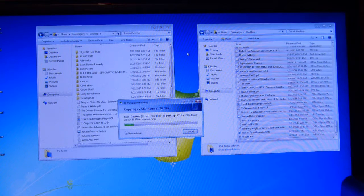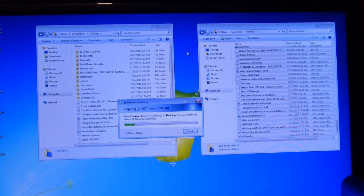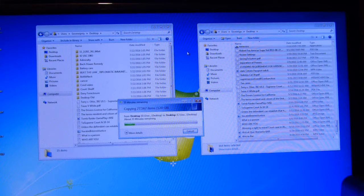With cloning it partitions everything over, but you can't do that when changing computers. Although you can clone Windows and it'll work in the same machine, Windows sees each machine as different. In this case I had an OptiPlex 790, and before that an AMD build with my own motherboard. Windows wouldn't run on the OptiPlex even though it had loaded successfully on my old machine. When I put the cloned hard drive into the OptiPlex it refused to run. The only fix was to boot from the Windows DVD, wipe and reformat the drive, and do a fresh install — then it worked fine.